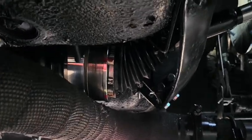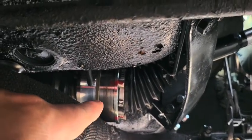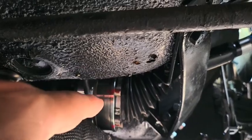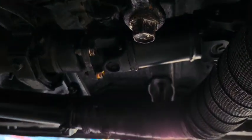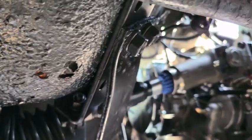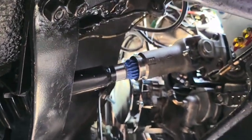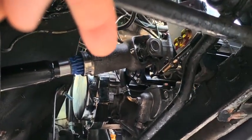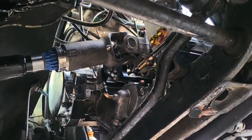This is the finished version of my driveline — I'm not going to change it anymore. That's the Porsche 930 CV, full floating. This is actually a race CV that I purchased from MP, and it goes to my reverse box. That goes to this tiny driveshaft, then to my main driveshaft into the rear end. I have my driveshaft loop, my modified shaft that goes into a slip shaft, then into the U-joint and to the transmission of the Hayabusa.